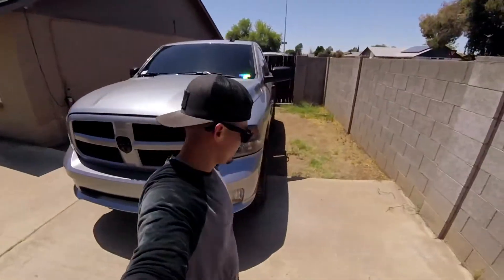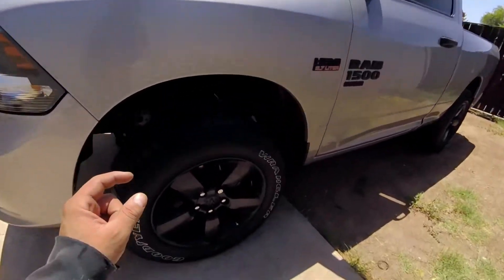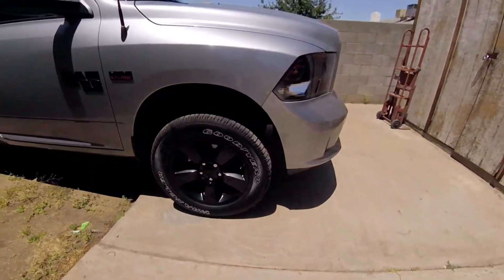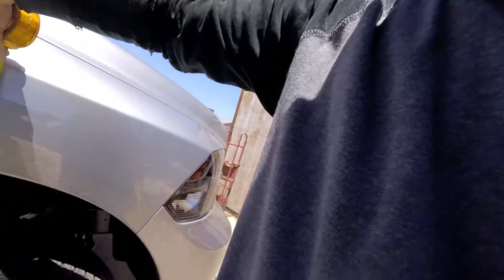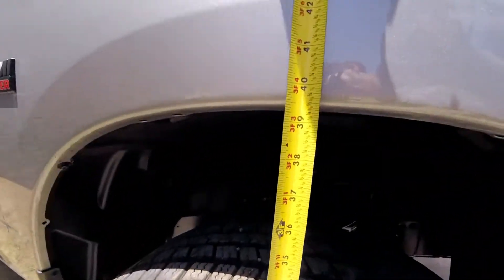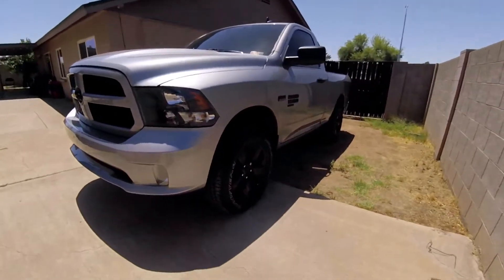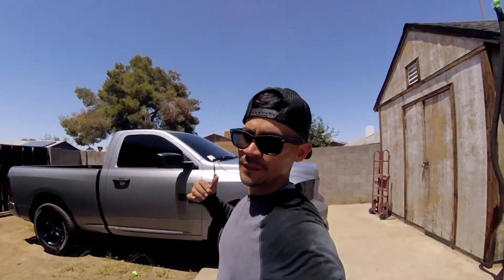There she is boys — finally got her leveled. The first leveling kit I did on a four-wheel drive 1500 I didn't struggle as much. I did struggle a bit here — I didn't have to go to that extent of getting that tool the first time since a couple of guys muscled it, but if you're doing it by yourself I really recommend getting that tool, and use a ratchet strap. The passenger side was 37 and a half, now it's at 39 and a half. The driver's side was 37, now it's at 39 exactly. I'll take it out, ride it for a bit, let it settle. Turned out pretty good. If you like the video, hit the thumbs up, subscribe, and drop a comment about what you think of the build and the single-cab conversion idea. Thanks for watching — see you in the next one, peace.